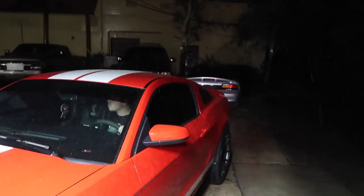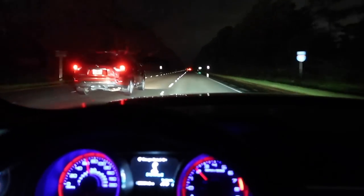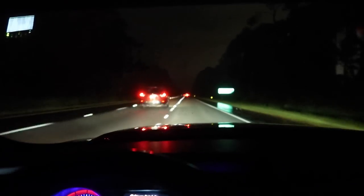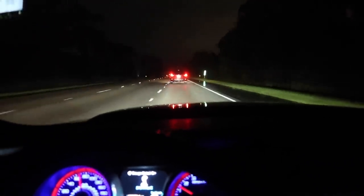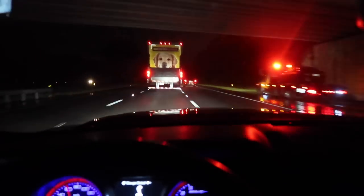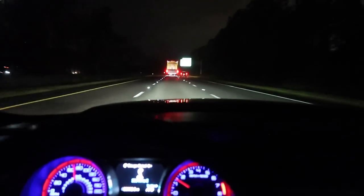In terms of noise — a lot of people talk about noise with an upper control arm. As of right now I have not noticed any difference. My car has always had a little hum in the back, which is very common in 2013-14 GT500s. Going 60-70 miles an hour in sixth gear, I really don't notice any difference in NVH. No clunking in the rear, which is a major concern — that's why we went with poly rather than a spherical or solid bushing. The poly insulates the metal and we greased everything, so pinion angle is still factory. So far everything seems good.